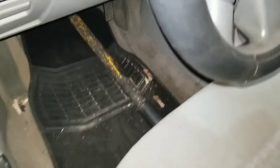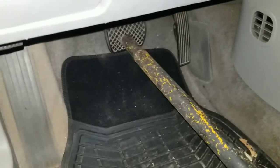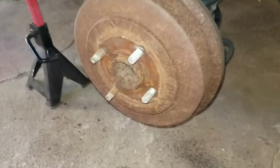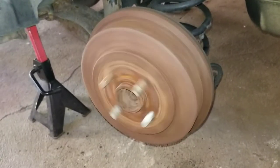Nothing on the floor. It's got to be an internal leak, which is gonna be either the master cylinder or even the ABS module. I wedged something between the brake and the seat so I have the brake pedal depressed all the way - you could see the brake lights are on. Now I come to the rear drum, this is the driver rear, and mind you the brake is still applied - you see the light is on - and just by hand it spins freely.